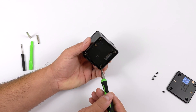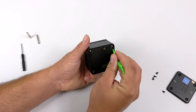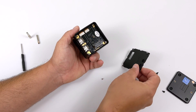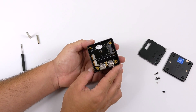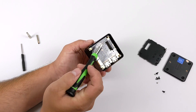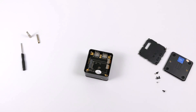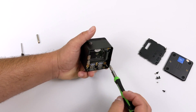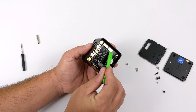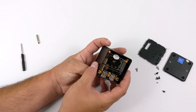There's another four smaller Phillips head screws that we need to remove. I actually expected that to be a bit harder, but it just kind of falls right out. One of my studs actually came out with the screw — might not happen to you, but just keep an eye on that in case you think you're missing one. Now I'm going to call this the expansion board, because there are actually two PCBs inside of the Lark Box. In order to remove this expansion board we need to remove four studs — only three here because one already came out. We also have two little ribbon cables, or quick connect ribbon cables. I'm just going to pop those up, and from here the expansion board should pretty much just slide out.